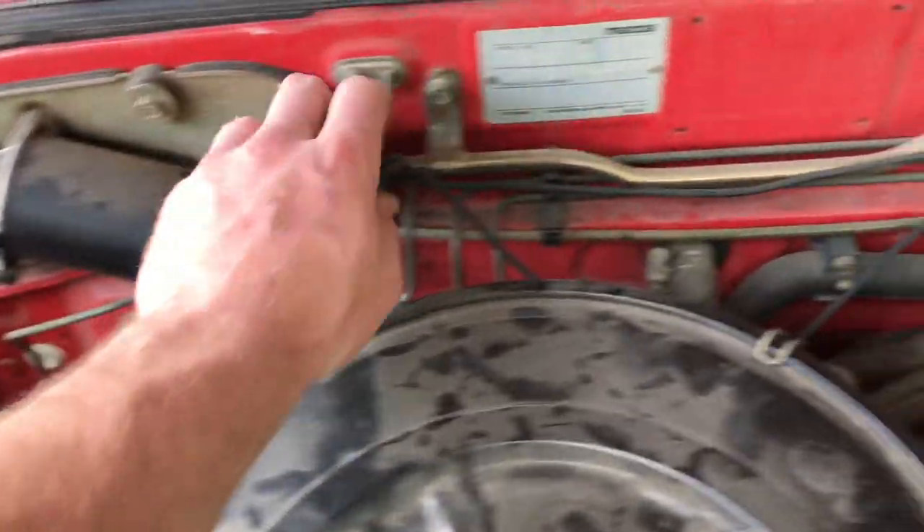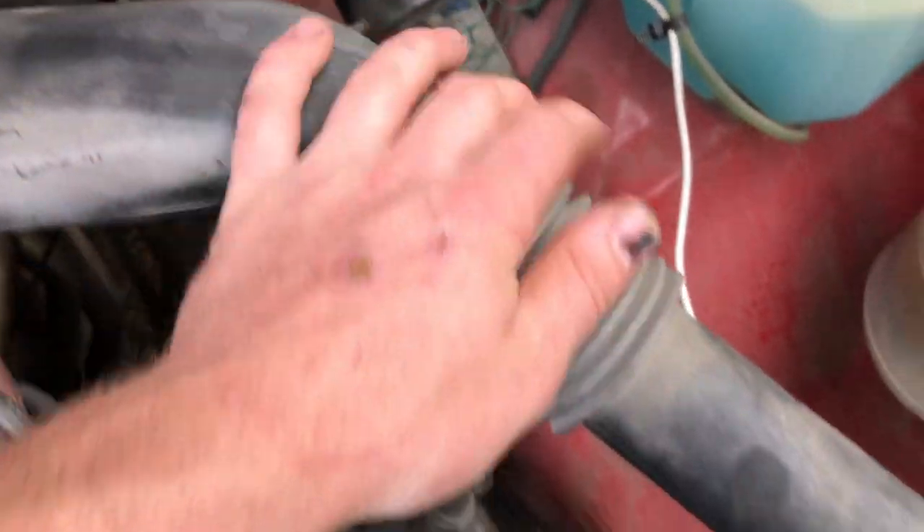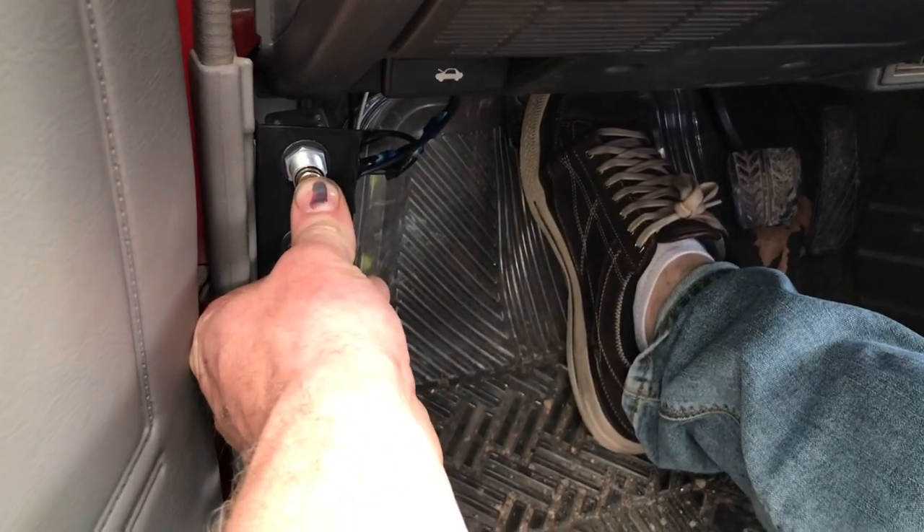Now we're going to look at this mess going on here — you can see it goes over here. This got me home one day when I was super pissed off at work. That leads us to the fourth thing I can't stand about these pickups: the ignition switches. Half of the Mazda pickups I've had, the ignition switches have gone out and I've had to repair them. I could buy a new ignition switch, but I'm cheap and I don't want the same thing happening again. What happened is I'd be cruising down the road and everything would just shut off. On another truck, I'd have issues starting it all the time. So what I've done is put in a push-button toggle. I've done this on half of the Mazda pickups I've owned — I just run a wire between the starter and the coil and then run a push-button toggle, completely bypassing that issue. The only thing I need my key for is to unlock the steering column so I can still steer. I could hide that button so you couldn't steal my truck, but I'm really not that worried about it. If you don't have a key, the first time you turn the wheel it's going to lock up.